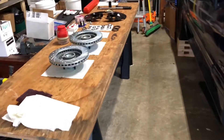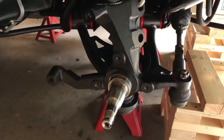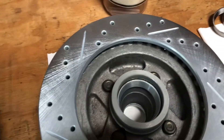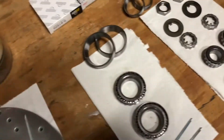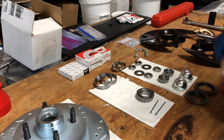Hey guys, welcome back. Today we are getting the rotors on - new bearings, dust shields, everything, the whole nine yards. We'll show you how to pack these bearings. I don't have my struts in yet so my spindles are just tied up temporarily to keep it from falling down once you get the rotor on there. Here are my rotors - as you can see they've already got the races in. The bearings come with the races but we won't need to use those races, we're just going to use the bearings and pack them with grease.